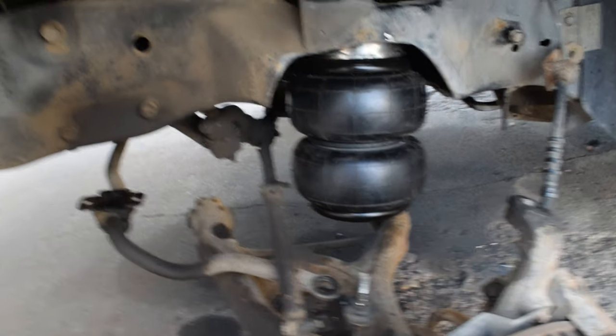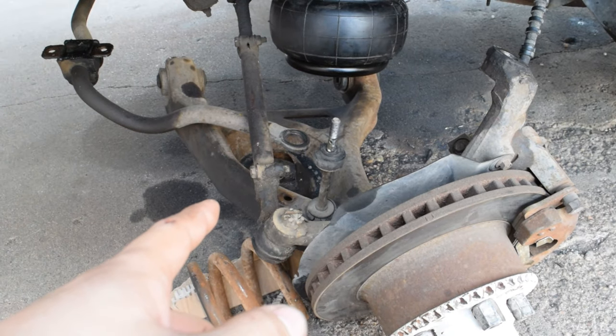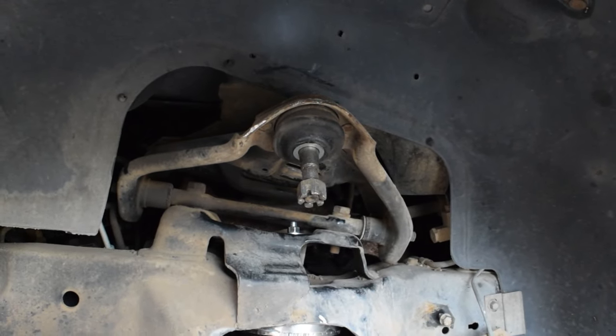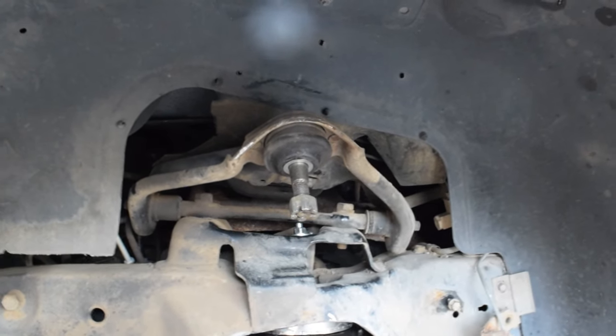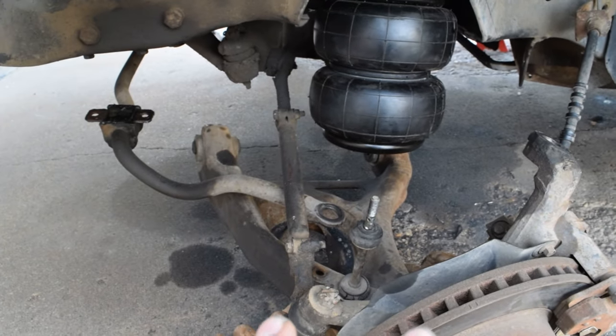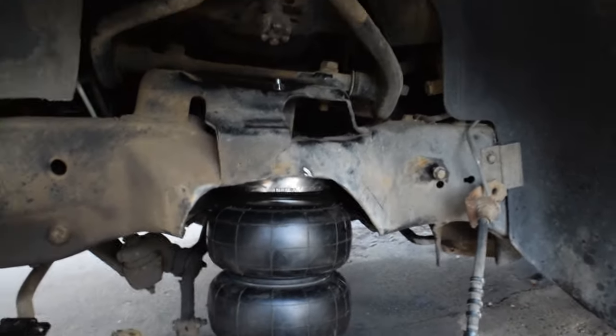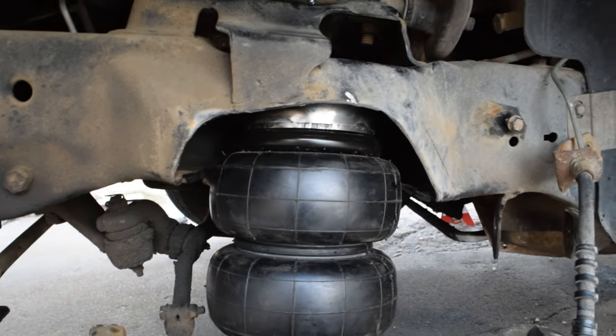So as you can see, you gotta take the sway bar off. Take that Johnny off. Did take off the upper ball joint already. It's actually the first one I've been able to separate without messing up. So that's cool. Actually remove the two bolts out of the lower arm, drop everything down. And as you could see, I did cut the ever living fuck out of it already.